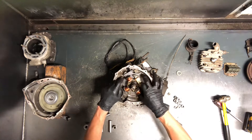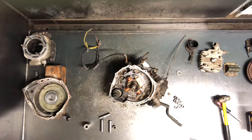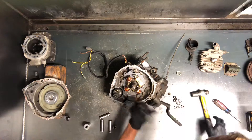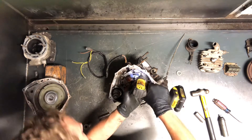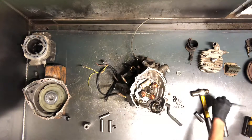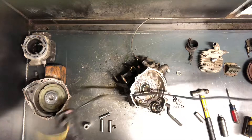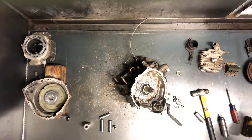Then we've got Phillips screws — three Phillips screws holding this plate on — and then the wires running out here. They look like they've been done before, not in very good shape. So we're going to use this impact driver. One hit with an impact driver and a lot of times that will take care of it. Your stator plate is off. You can replace just the coils there if you want to. If you're getting them aftermarket, pick a name brand manufacturer — somebody like Rick's. You don't want knock-off junk.